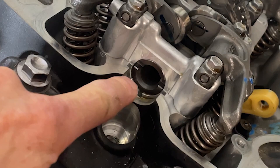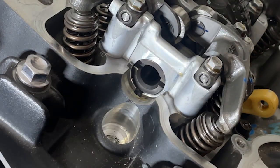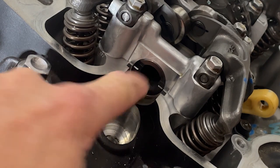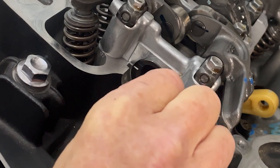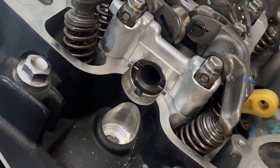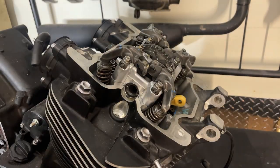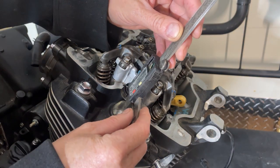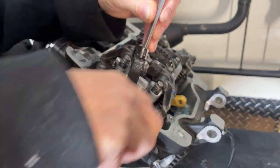What I can do is actually grind down an eight mil drill. What I'm going to do now is make a tool to lock this camshaft in place so we can time it up - I need to measure the thickness of that slot. Drills come in handy for this sort of thing as well. It's just over five mil, so if I can find a bit of five mil steel plate that should work. I'm going to measure that with my calipers so I can take this out to find a piece of metal.